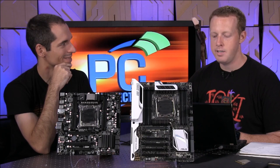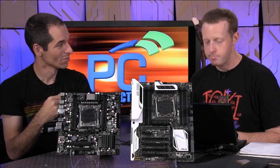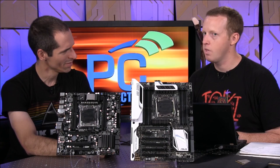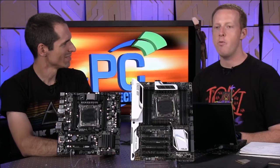You're going to add a lot of power because of that. So the TDP is 140W at stock, and overclocked you're going up to maybe 240–260 watts — kind of linear. We could probably do some tests overclocking to certain levels, but you want to be at the minimum voltage for each overclock to really be accurate. For such a big percent overclock to have a similar percentage power draw increase is good.